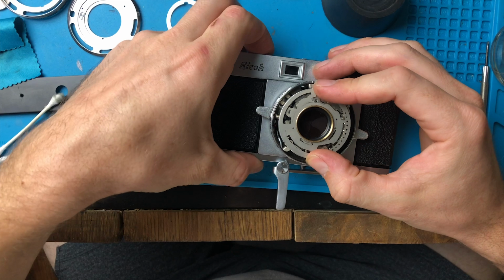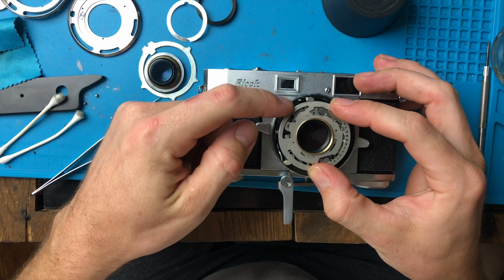So when I got this body, the focus pull here had completely seized up. The oil and greases and the lubricant that is used on those joints had completely seized. So that was an absolute pain to get in there, kind of scrape out what I could, and then use some cleaning materials and stuff, and kind of get that moving. But now it is actually really smooth. Fix that, and then inside the shutter blades were soaked in some other substance, old oil or something, I don't know. And then some springs, screws, and tension rods had been moved around and causing the shutter to not function properly. But all that is back up and running. It's cleaned, it's good to go, and it is working just fine now.